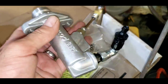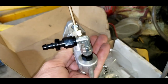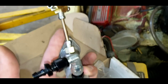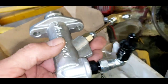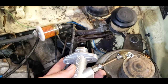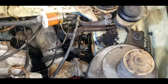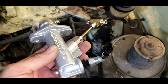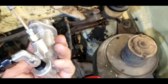The orientation is a little off. The flange here is the same as long as the master cylinder is on its side — it's designed to be used like this. This is the inlet for the fluid, low pressure, and this is the outlet, high pressure. I've made adapters for both. My plan is to install it in place of the factory master. That factory master is a 3/4 and it works fine when you have the power brakes attached, but when you don't, the pedal is rock hard. I want something with the smaller bore that gives me effectively more leverage and pressure in the braking system.